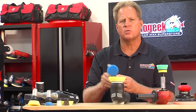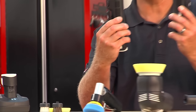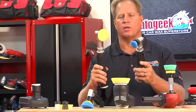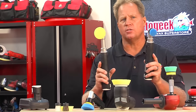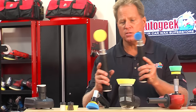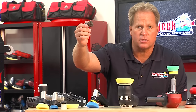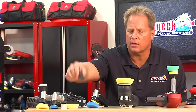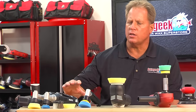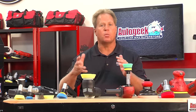You can do compounding, polishing, and probably even some waxing with the TA50 if you have small areas to work on. These are the Rupes Nano Hybrids — they come in both a short neck and a long neck version. They're battery operated, but you can also run them with the included power cord in case the batteries run low or you just want extra power. What makes these tools unique is you can use them in both rotary mode and dual-action orbital mode, depending on what you want to do. They're designed to run 1-inch and 2-inch pads. You can also get little brushes that attach to them for light scrubbing, engine detailing, interior, leather seats, and the dash. You can get sanding discs for them to do wet sanding into small isolated areas. The long neck version is to reach into areas like the air scoop on a Ferrari or something like that.